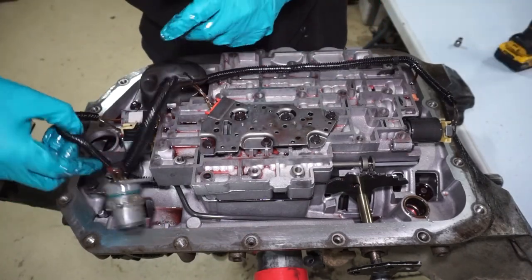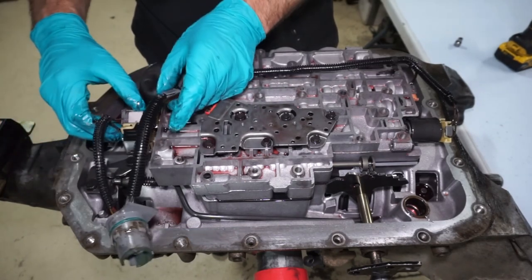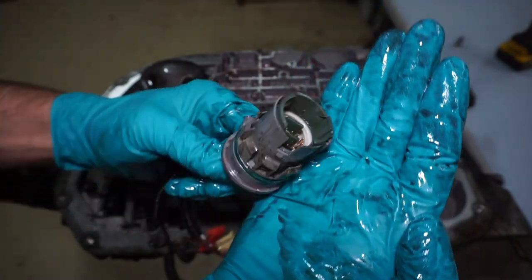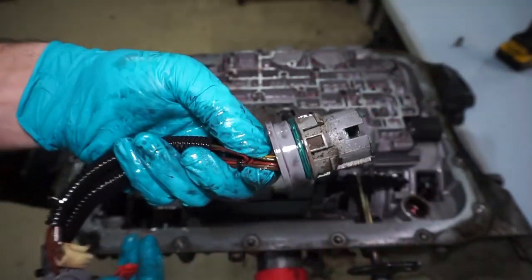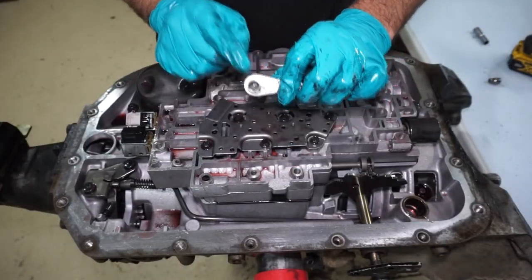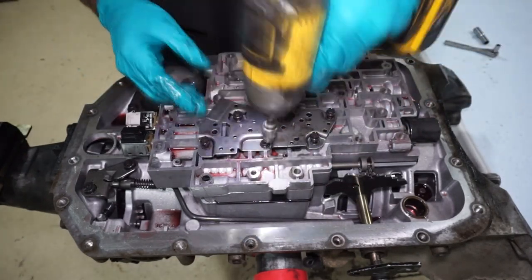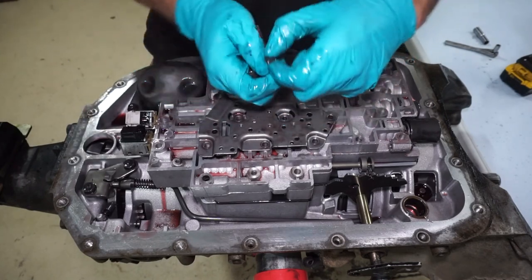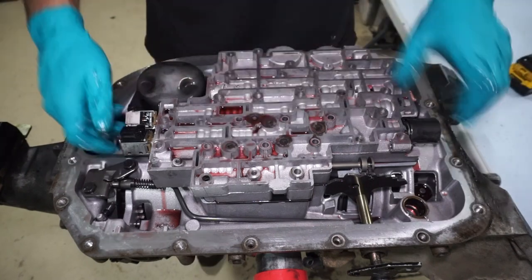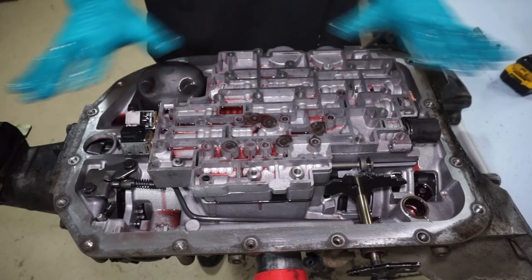Next, I'll get the harness off. The trans brake comes with its own plug that goes in the case, so you can wire directly through the new plug. We're just going to get rid of this harness — this one's all broken and kind of gooey on the inside anyway, so we probably would have replaced this even if we weren't doing the trans brake. I'm cracking the bolts loose by hand because my sockets are kind of worn; I don't want to round these off using an impact. We're not going to be using this valve body for the trans brake. We will be using the manual valve — the valve body and plate we're not going to use.